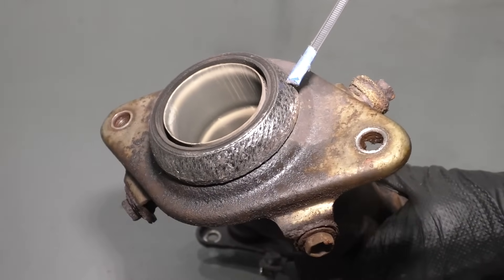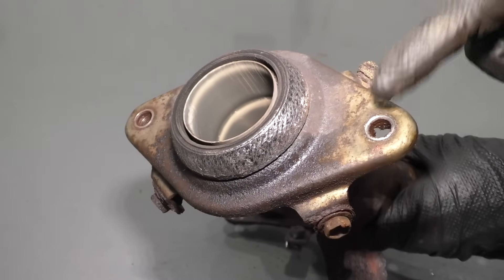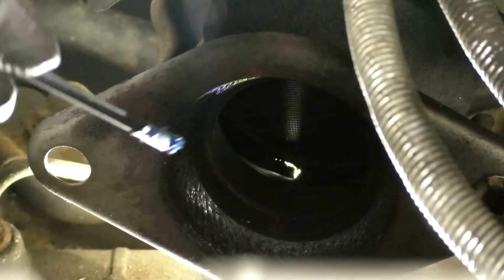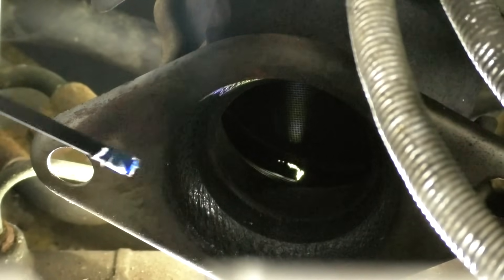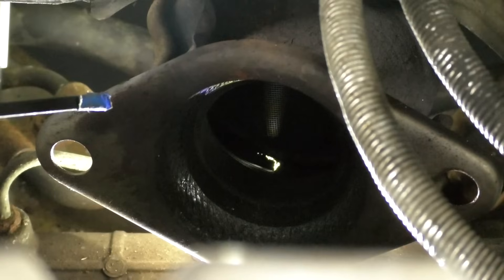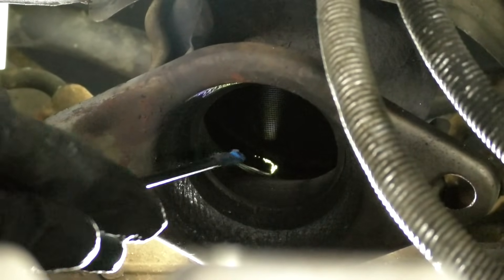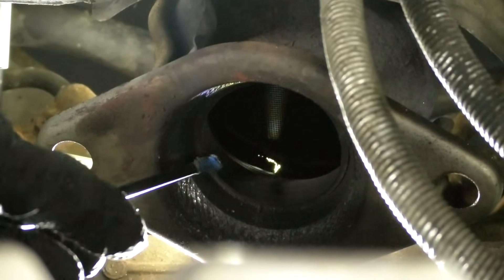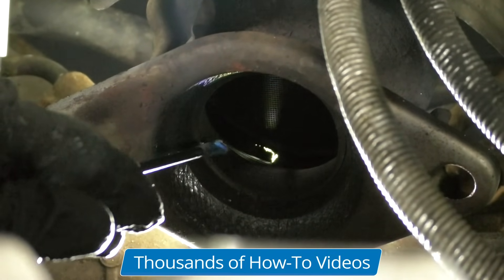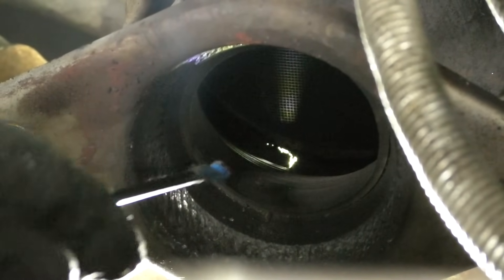One last thing I want to talk about on the manifold is the donut gasket — the gasket that goes between your manifold and the downpipe. Generally speaking, it's going to have spring tension on it because of those spring bolts you have to remove. It's very common for this part to leak, especially if your springs are loose. These pipes tend to have a lot of shields around them, and just like the manifold, around the shields is generally where you're going to find a leak. These shields are welded onto the pipe, so they're a little bit harder to get off. With the manifold out of the way, the best way to check for a crack is to look inside the pipe and hold a flashlight on the outside — if you see any light shining in from the outside, you definitely have a leak, generally right along the weld where the heat shield is put onto the pipe. This one needs to be replaced.